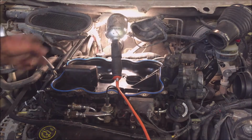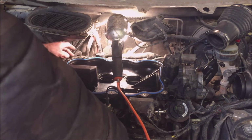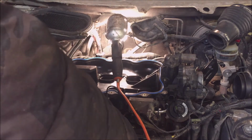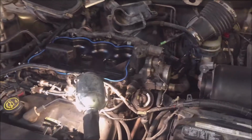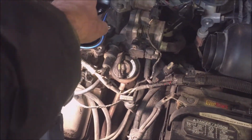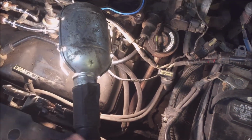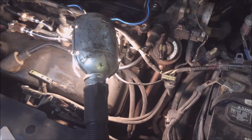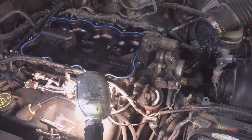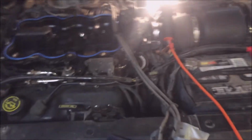With the top off, I can see in the back properly, so I'm connecting as many hoses and wires as I can see, because with the hump on it, I won't be able to see properly. Oh, one thing I noticed, the spark plug wires, I should have routed them over the top. Now I have to disconnect them at the plugs and then route them back, but I'll mark them. I was too focused on lining up the ports and the spark plug wires.